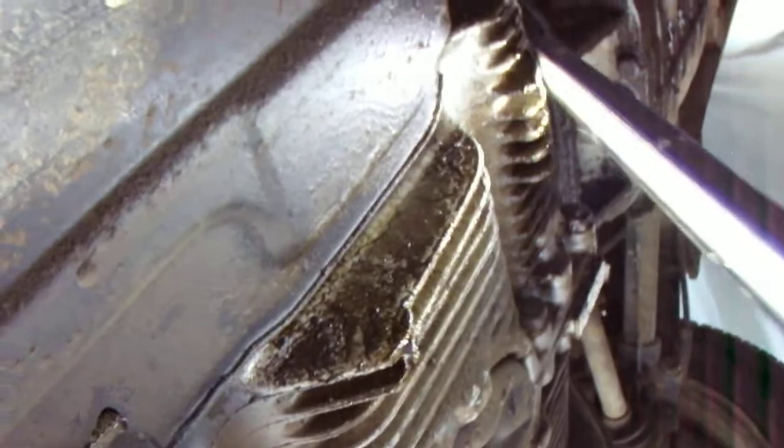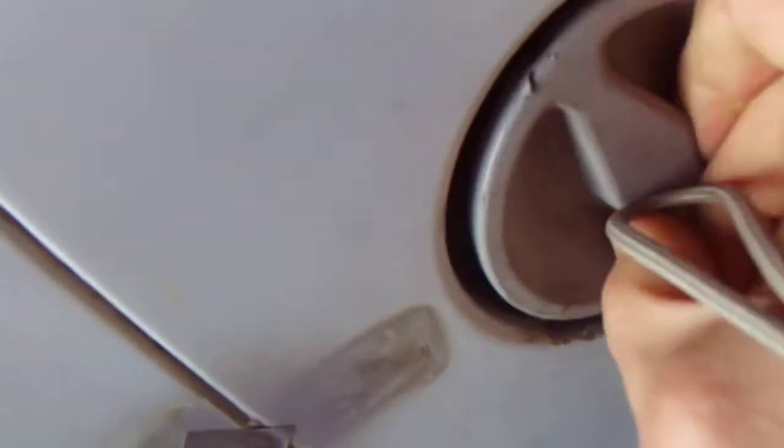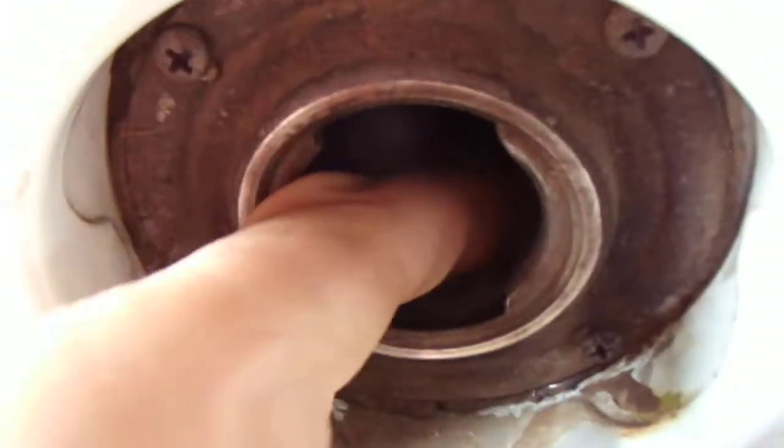While we're at the engine, there's a bit of an oil leak on this one here — that's from the fuel pump gaskets. Just a minor one from there. That's unplugged. Otherwise, there's a hole there on the muffler. Always check your filler — there's a rubber elbow in here. You can stick your finger in there — always stick your finger in there and feel to make sure it's not all split. It can cause fire issues and fuel smells.